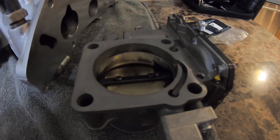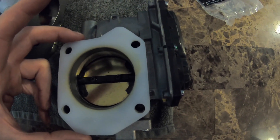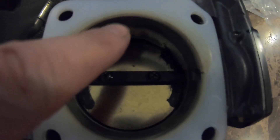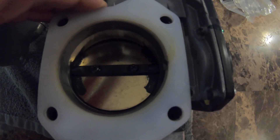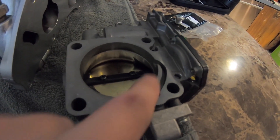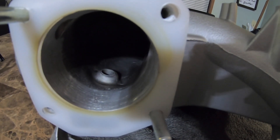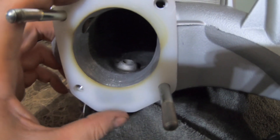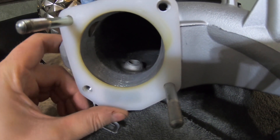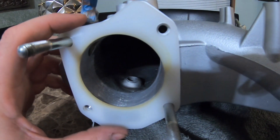Because the back of this — this is a J35, it is brand new — so when you put the thermal gasket up to the back of the J35, there is actually like a millimeter or two of the back of the throttle body showing when you have the gasket up. If there is no material here, you are definitely clearing, because this opening is a little tiny bit smaller. Now that you open this up, there will be a seamless transition through — no lips or anything to create any turbulence. I don't think this is going to gain you a ton of horsepower or anything like that; it is just going to let you take full advantage of the J35 and the extra air, so nothing is getting in the way.